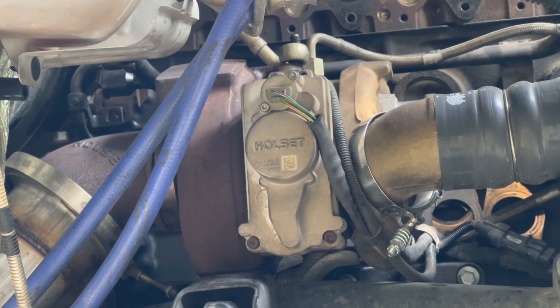Those are really the only two failures with this turbo. They can handle about 40 PSI reliably - they're only tuned for about 30 PSI from the factory - so you can turn them up another 10 PSI, but you need supporting modifications to your engine, usually head studs, because you'll blow a head gasket.